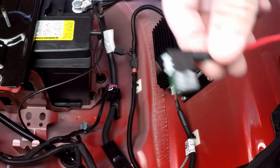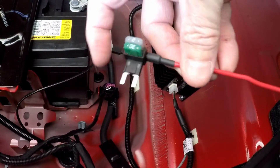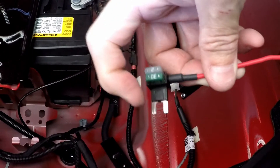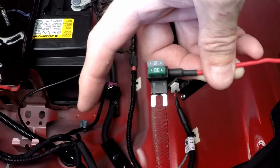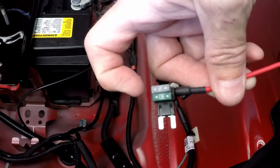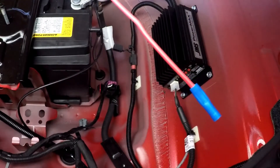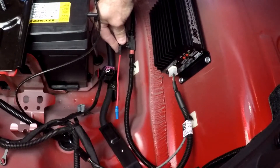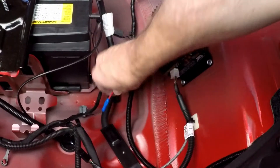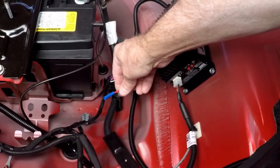What I'm doing is I'm adding a fuse tap. Power comes in this one, goes across the 30 amp, and then out this one, and then out to the fuel pump control module. Then power comes in this one, across the 2 amp fuse, and out the red lead. I'm just going to plug that in there like that. And this end here is going to be the positive for the voltmeter on my dash. Then I'll just attach a ground.